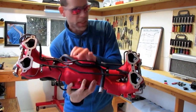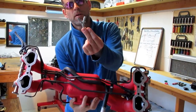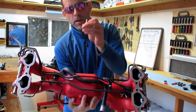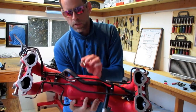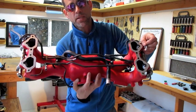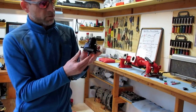The stock lines are actually cut right here and right here. I'm going to use this aftermarket stainless steel Y-splitter, mounted somewhere in the engine bay about here. Incoming fuel hits this side, splits the incoming fuel line into two, so you get even fuel pressure going to both fuel rails. That's basically the system in a nutshell.